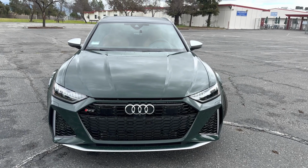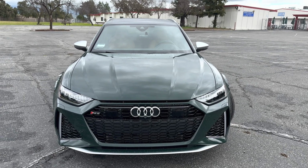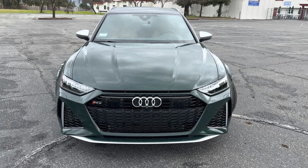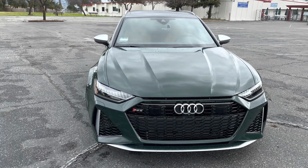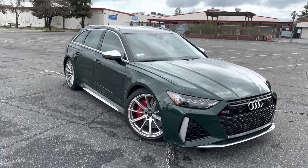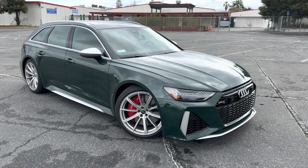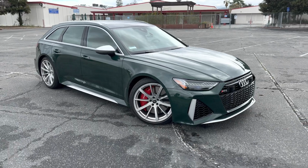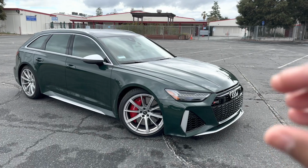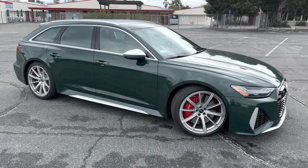My guess is, if you folks remember, when the current generation A8 was announced or launched a few years ago, Audi did in fact have plans to enable level 3 autonomy on it as part of their ZFAS platform. It's German for essentially centralized driver assistance systems. But I think for regulatory and other reasons, they decided to skip having level 3 enabled either here in the US or worldwide. Nevertheless, the hardware is included, and again, grossly over-provisioned hardware for the actual feature set enabled on the car.